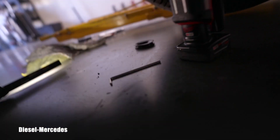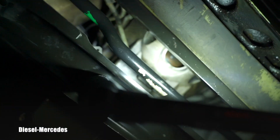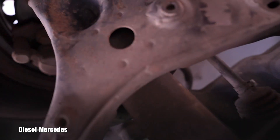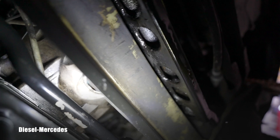That little plug — the ordering number from Mercedes-Benz — comes with its washer. It's a four-millimeter hex. The big long socket doesn't fit there, so you need to use the small one. Also interesting: this vehicle doesn't have normal steel springs. It has a fiberglass leaf spring doing the front suspension, with only dampening shocks on the sides.